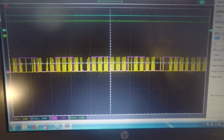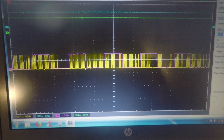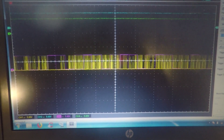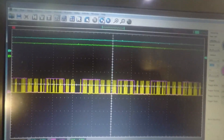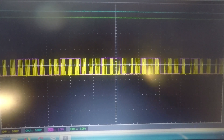After several minutes of idling, the signal started looking different. You can see that the cam signal remains steady and the rising and falling edges are right between the crank signal, but the crank signal is not always there — some of the groupings are missing. Based on these readings, I ordered a new crank position sensor.